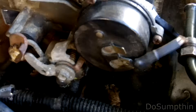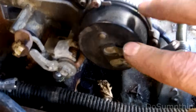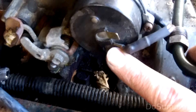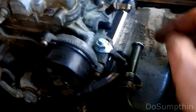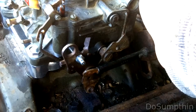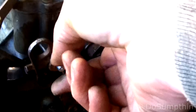This carburetor has an electric choke with two wires: a positive 12 volts from ignition and a separate ground. I made a pigtail wire and I'm going to try to steal a ground right here from this mounting bolt. On the other side, the throttle cable hitches right up there and there's a little cotter pin that goes in. And here I'm hooking up my new throttle return spring.